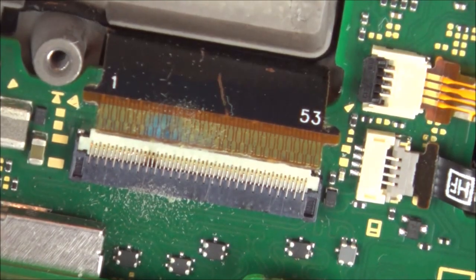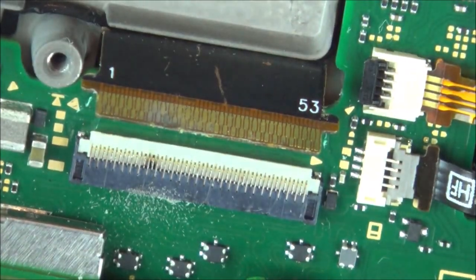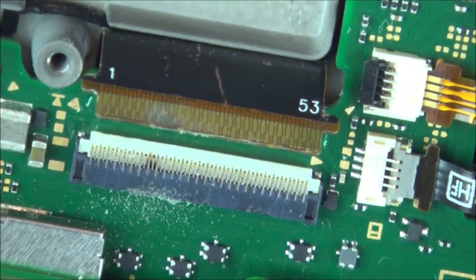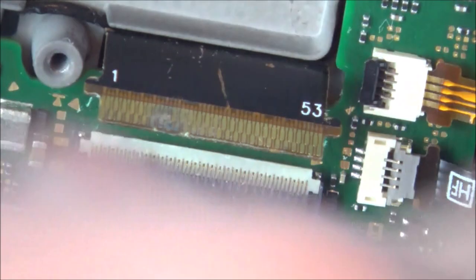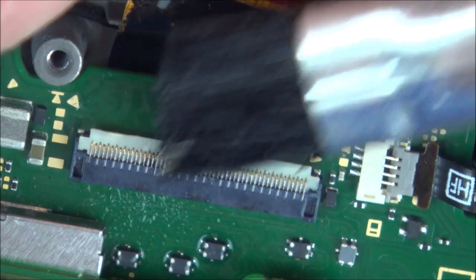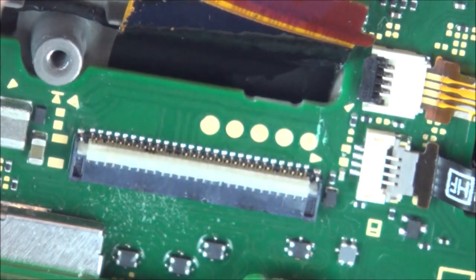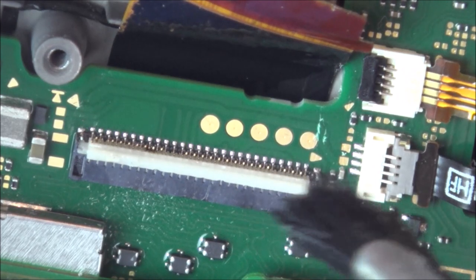I think the ribbon cable is going to be okay — it's just the actual board that looks a bit bad. I'm going to get some IPA and try to clean up both of them. IPA is 99.9% alcohol — I'm using a little flux brush in it to give it a clean. The one connector I hate on the Nintendo Switch is this one here. Good news is you can now buy them, but I wouldn't be confident soldering it back on because it would just melt straight away.